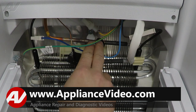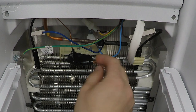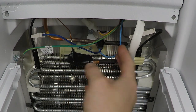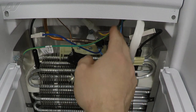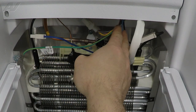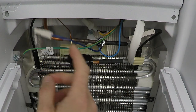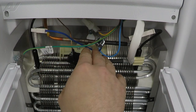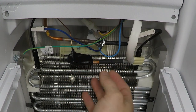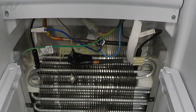Sometimes you can see the top will be blown up, or there will be some holes in it — I've seen the back end start to fall apart. This is a clear indicator that you need a new defrost bimetal. Another way to check it, if it is not blown apart, is you can undo the wiring to your heater as well as undo the wiring in the back, and check between the light blue wire and this — it should have continuity through it when it is ice cold. So if you're having a defrost problem and it is covered in ice and you do not have continuity going through it, it will need to be replaced.